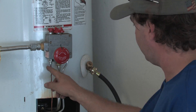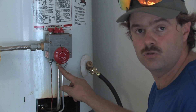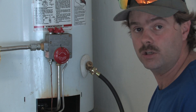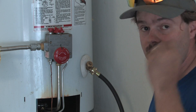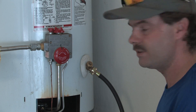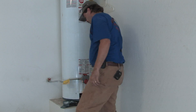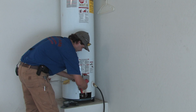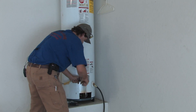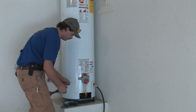You remove all three lines, remembering that the center one — especially if it's on a propane unit — will be reverse thread, so you'll have to spin it the opposite direction from the standard on-off direction. Be aware of that because you can damage the gas valve. Once again, if you're not comfortable with this, get a certified technician out. After those three lines are removed, remember to also remove your gas line that's hooked in by simply threading it off. With your gas off, there's no hazard in doing this.